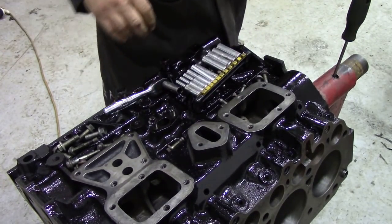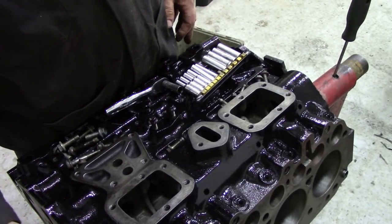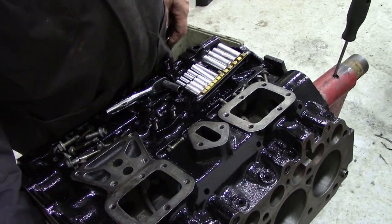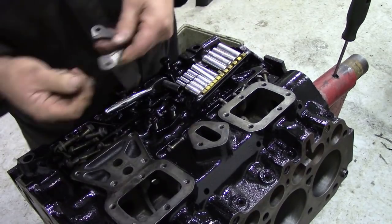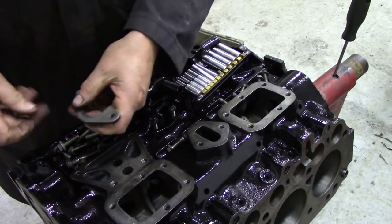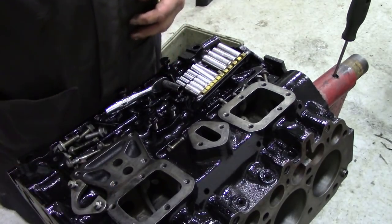The next thing — we're going to fit the camshaft. So that involves taking off the little end plate off the front, and then we can build up the cam and the cam followers tonight, but we can't do much more. There's the end plate. Those are the bolts that go into it. So we're going to get the cam and show you what to put onto the cam.